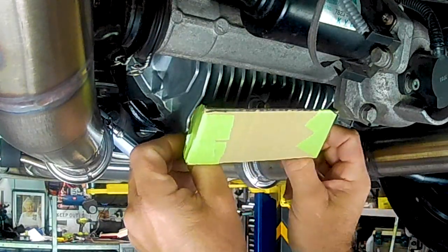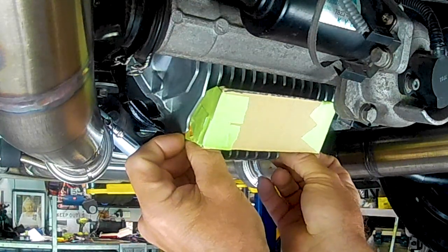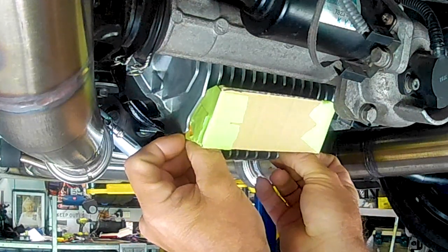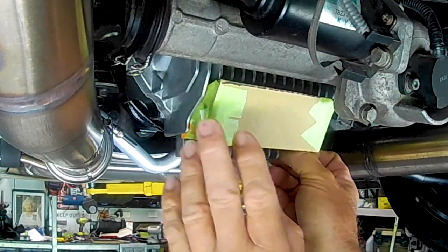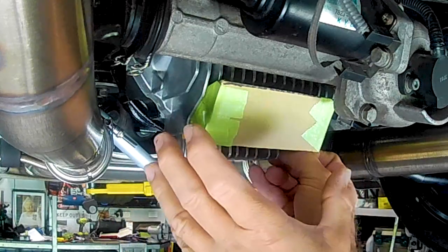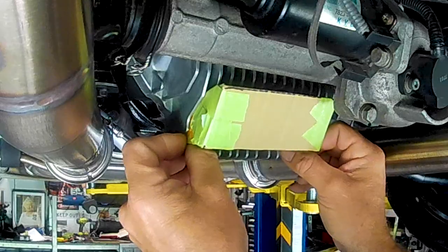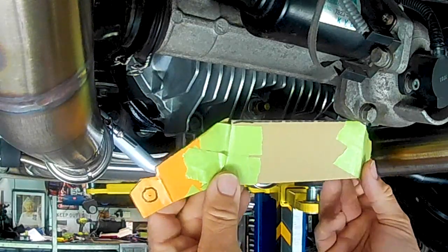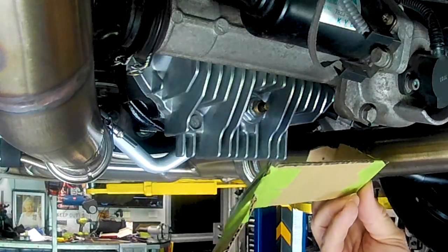So this will fold over, goes in where those two bolts are, and creates a bracket like this. Now, what that does, it gives me this face here to drill through and maybe put some riv nuts in or something to hold the main cover, and hopefully it should all work. This was my final shape after I worked out all the distances and everything, but I've got another one here that I'll show you.